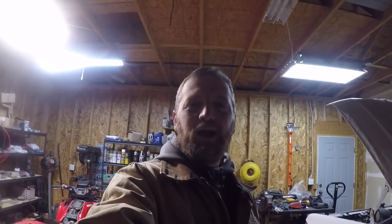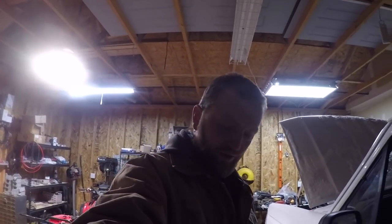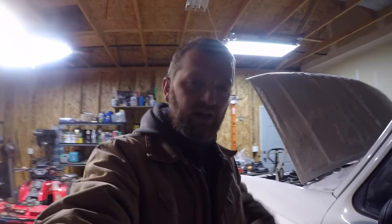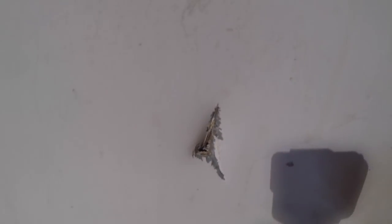If you apply just your trailer brakes and not your pickup brakes, that basically anchors the back of the trailer and everything will pull straight — works great when your trailer brakes work. Ladies and gentlemen, I grabbed my brake controller and hit the lever for trailer brakes, and there were none. I would later find out from Brandon he knew there were no trailer brakes and just failed to mention that little tidbit, which would have been very nice to know before taking off. Regardless, the truck jackknifed with the trailer, and what saved it is the fact that I did put this flatbed on — because right here, the damage in the powder coat is where the upper horizontal part of the gooseneck hit the bed and stopped it from crushing the rear of the cab.